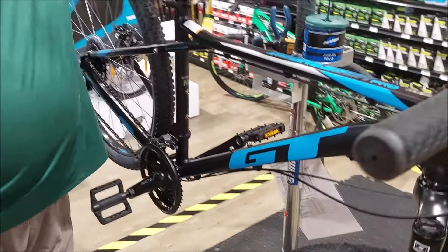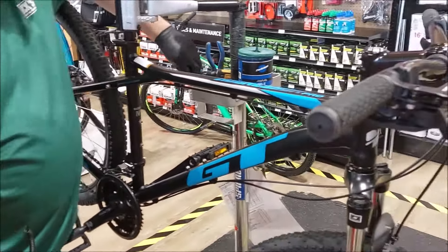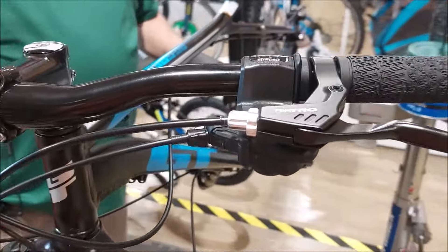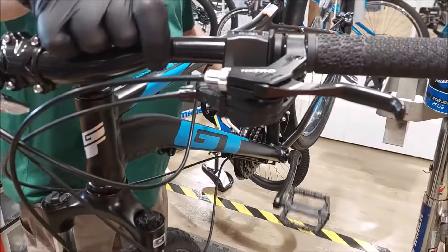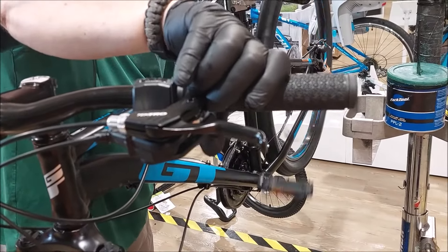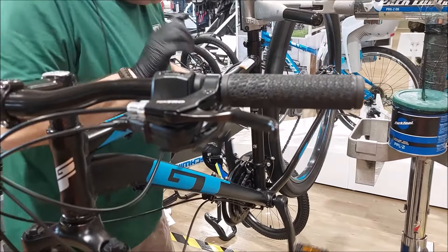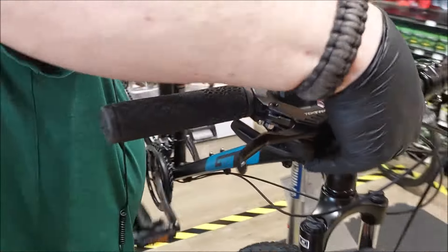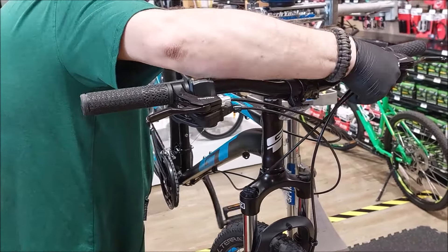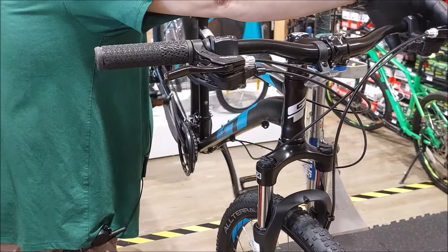When you said you pulled it through and locked it in place, you just tighten this little bolt — that's it. I'm going to be using a four-millimeter or five-millimeter hex. Same principle on the front — the only difference is I don't have a ferrule nut on the front-end derailleur, I have it on the shifter. I want to make sure I've got the right amount of throw, so I'm actually slacking the line because there was too much tension.